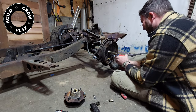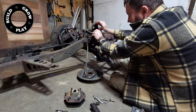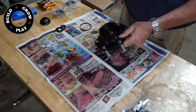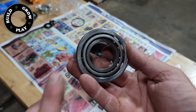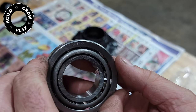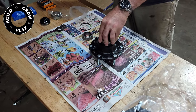Be wary of going on auto parts supply stores and ordering everything you think you'll need, because they don't have all of the right parts listed for this old truck, including the front wheel bearing. This is the inner front wheel bearing and Nissan no longer makes it. So I've had to buy this NTN Heavy Industries bearing — it's a 302-32.